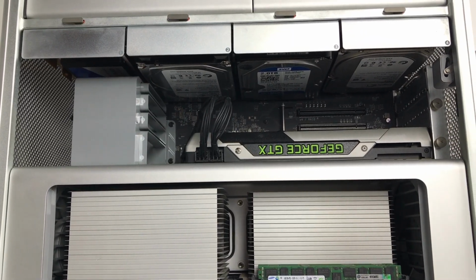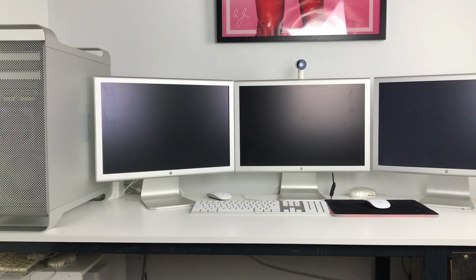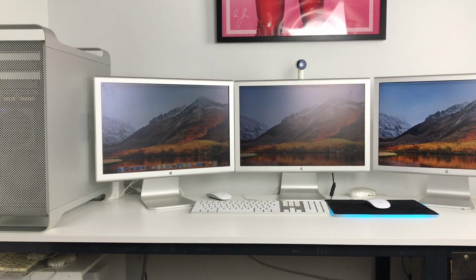With all my data now installed, it's time for a first boot. Now with the flashed graphics cards in the Mac Pros, they take a little bit longer to post, sort of like the PowerPC Macs, and it has a lot of text on boot. But an advantage of having a Mac flashed graphics card is, of course, you can still access the boot menu and see some of the progress on boot. Now I noticed after turning on FileVault that the boot screen is then black, and you also don't see the Apple logo, and the progress bar is actually just over more text, so it doesn't look as good if you have FileVault turned on, but either way it works just fine.